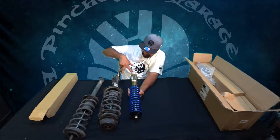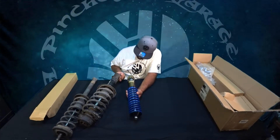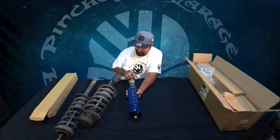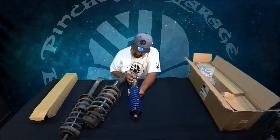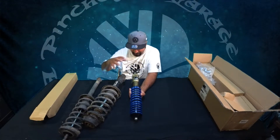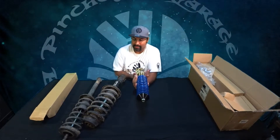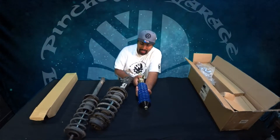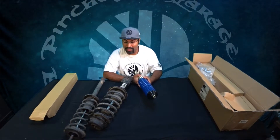The bottom right here is identical to the factory unit — they built it to a T. So if you need to bolt in brake lines or any sensors, they are identical. You're not compromising or trying to figure out a way to remount things. This is done correctly, and with weight reduction on top of that. These are actually stiffer springs, so you're going to ride a lot better, especially on the Mark II.